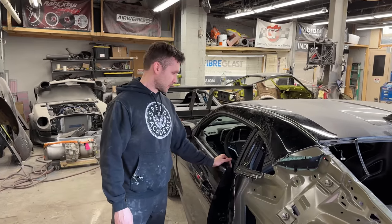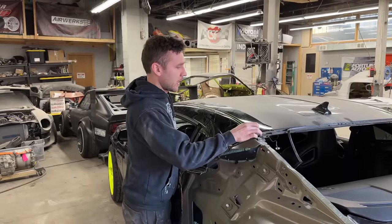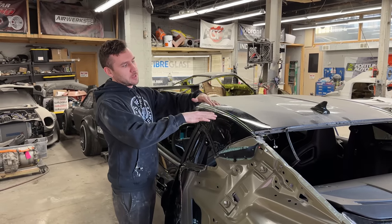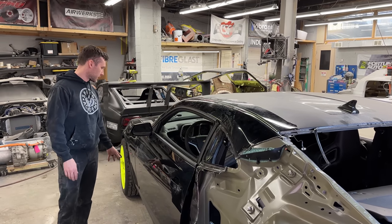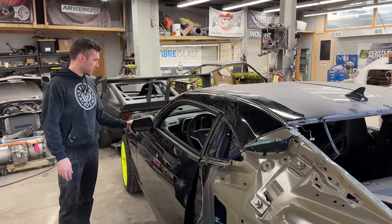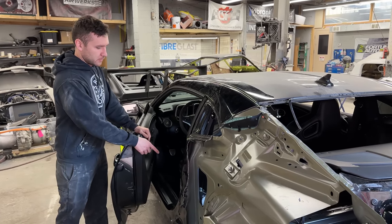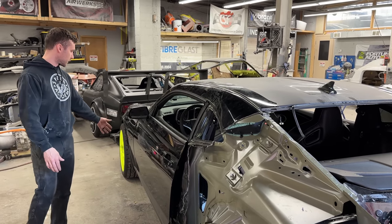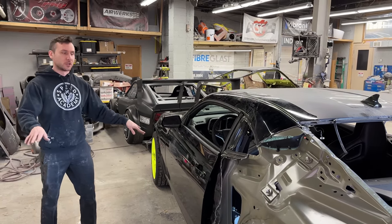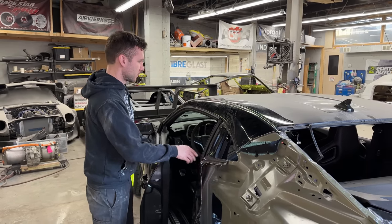Alright man, what's the plan of attack? You cut it at a good spot here because this quarter actually mounts underneath the roof. We can take some of these spot welds back and peel the roof back a little bit without damaging it, then slide it back in underneath and weld it all the way through. The quarter panel will come with the whole A-pillar and everything like that, but since your A-pillar is fine and your hinges are straight and you got this all to line up, that's a good place marker to make sure that when we put the quarter on and test fit it, if it's lining up with this door — which is lined up with the fenders which hasn't moved — we're good.